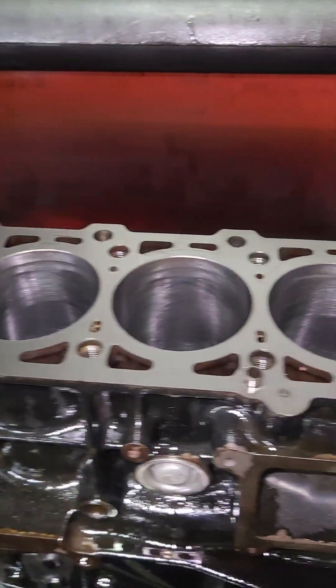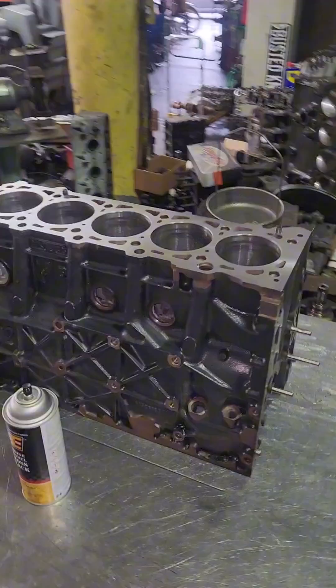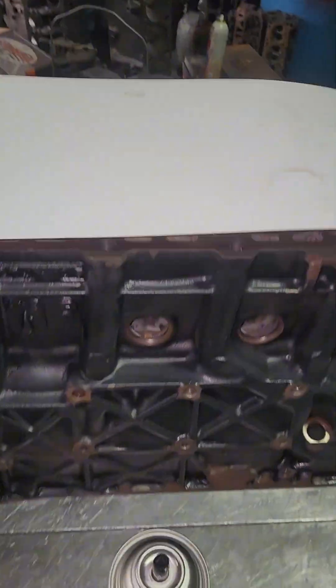Alright, this is what it looks like when I'm all done - I just finished plateau honing this thing. Let's pull this block out and get the other one in there. Second block's in the machine, and I just pulled the first block out of the wash, so let's throw some paint on it. I'll hone on that block for a second and be right back.